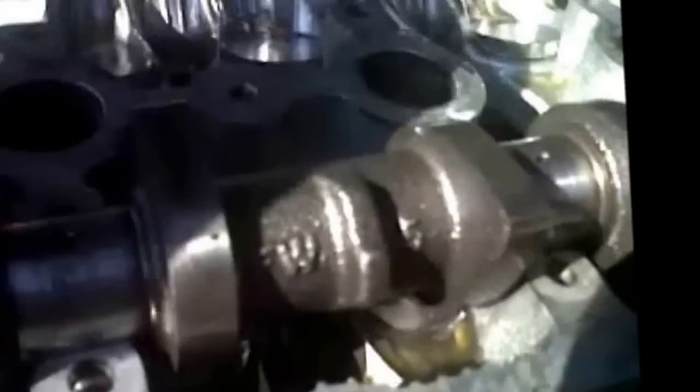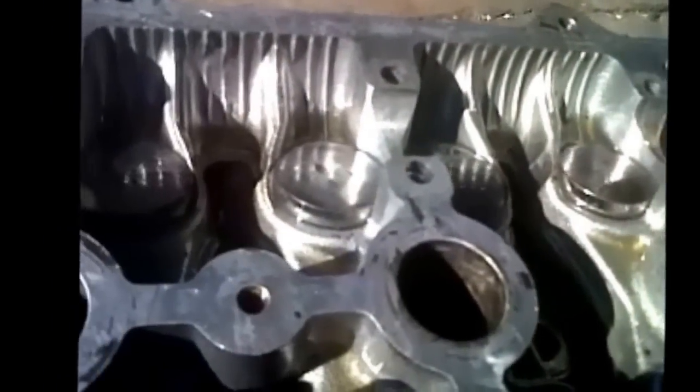We're going to put the caps to hold the camshafts. Once they're pressed in, you can see the sensor here — the spark trigger must be near to the sensor. If it's too far, you're not going to have spark. You can see the lobe for number one cylinder is facing toward the exhaust at about 11 o'clock, and the number four lobes are facing toward the inlet manifold.